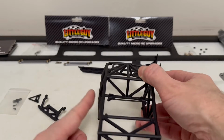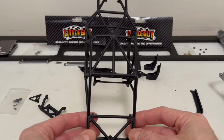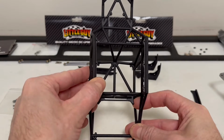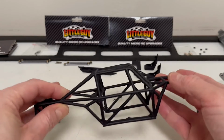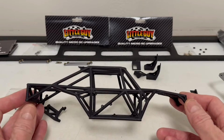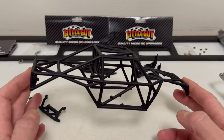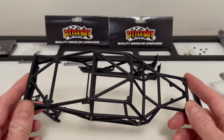It should be nice and vertical, basically like that side, as far as mocking up the panels and the sliders. This bottom one is just really twisted in, and it's a pretty stout plastic here, so that must have gotten heated and warped. A couple of options here. First, I'm going to contact Little Guy to see what they have to say, but I'm already thinking I may have to go at this with a heat gun if there's no other option, see if I can soften that up and get it back into shape.